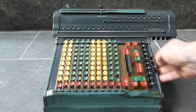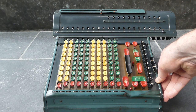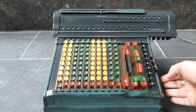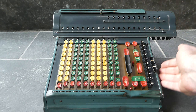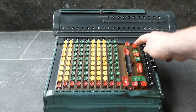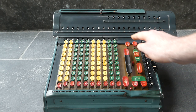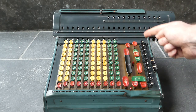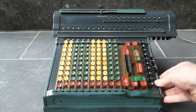The stop button is also used when you accidentally divide by zero. Normally when you press the stop button, it'll only stop once it's finished calculating the current digit — but when you divide by zero, that's never going to finish. Nevertheless, you can stop that division just by pressing the stop button twice. I'll clear the keyboard and just start a division now — see, it's never going to stop. Just pressing the stop button twice kills the division anyway.